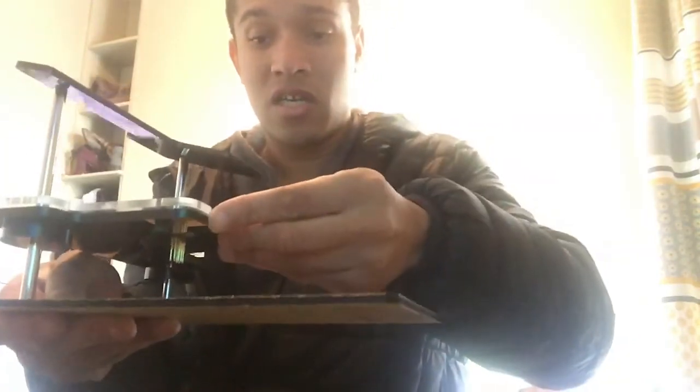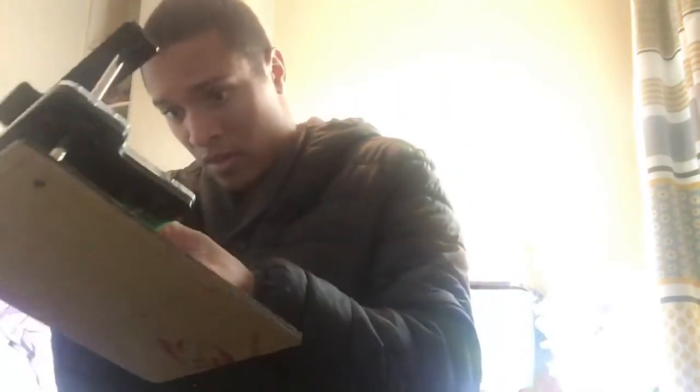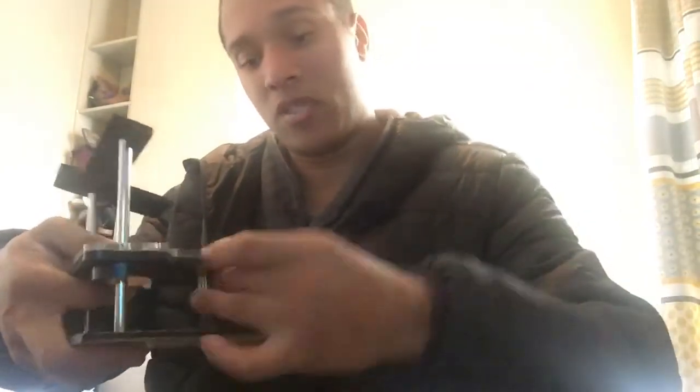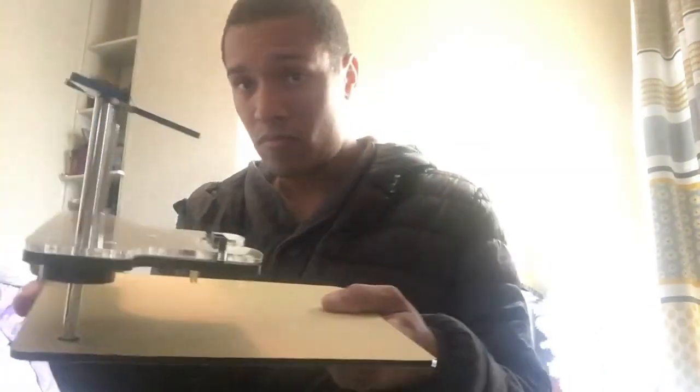If you do this it's still not the best way, don't get me wrong, but at least it stays in position so you can still maneuver around a bit. If you take another one and do it the same way, just keep in mind that you don't have a lot of space if you're working on an ECU. Make sure the screws don't stick out because otherwise you might damage your ECU. If you want to take it loose again you just unscrew one of those and it will work. Now it's stuck.